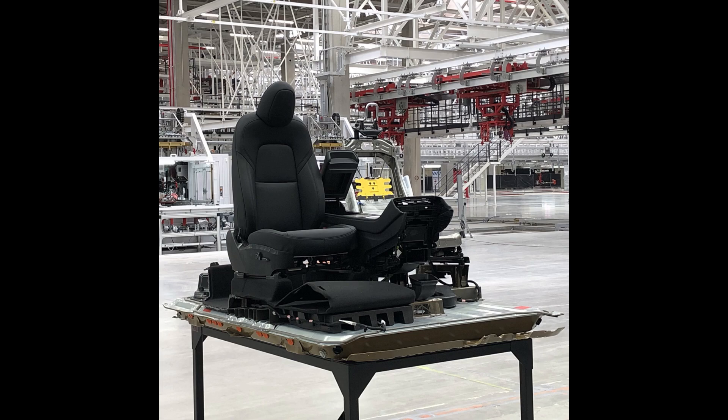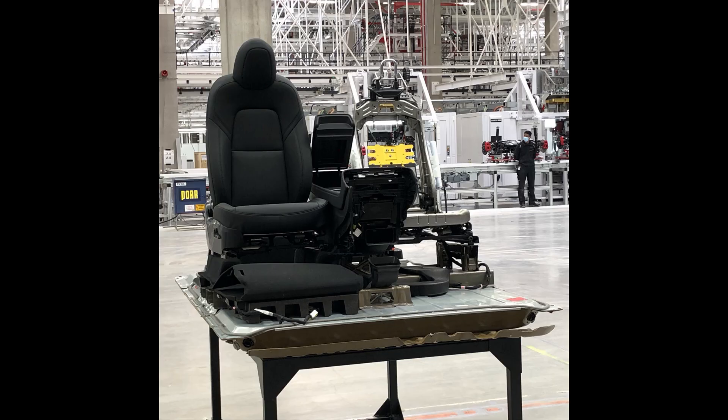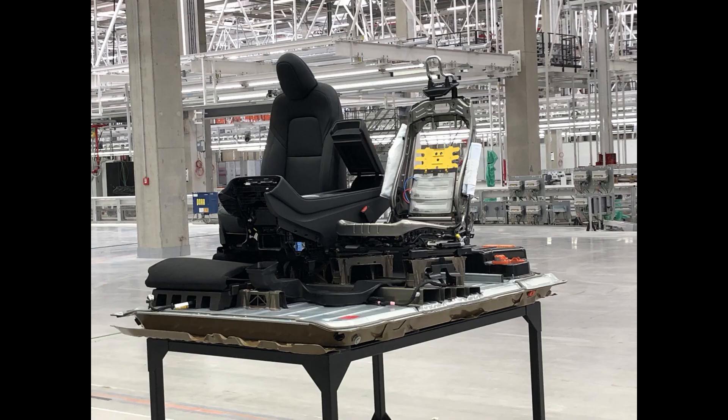The picture shows very nicely how the structural battery pack serves as the floor of the car. The seats and center console are directly mounted onto the top layer of the battery pack. You can see on the left seat a black double-floor plastic pallet, which on the upper side represents the cabin floor with carpet on top, and on the lower side yields space and channels for additional cabling, harnesses, and air conditioning channels. These pictures give a very good impression of how much you can now integrate outside of the critical path of final assembly.